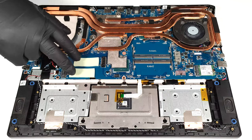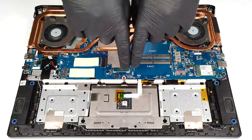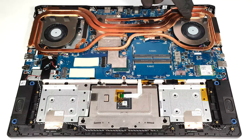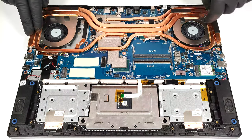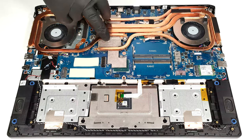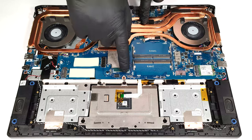There is a thick thermal pad in front of both NVMe slots. The Cooler Boost 5 system is huge — it has a pair of fans, four heat sinks, and four heat pipes shared between the CPU and the GPU. The fifth pipe is solely dedicated to the video card. The thermal solution also offers two cooling plates that are different in size; the big one on the left is for the GPU and it also makes contact with the chip set.